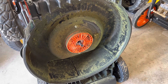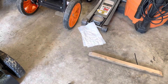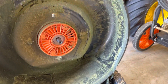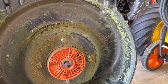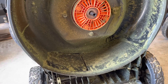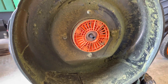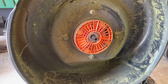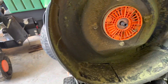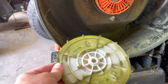So I gave it a rough cleaning — I just used a sharp stick to scrape it because I didn't want to damage the paint. From past experience, I know you want to preserve that paint as long as you can. So it came off easily. It's a 15mm bolt, it comes off easy, and it brings off the cooling impeller with it.